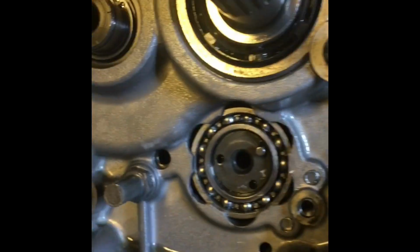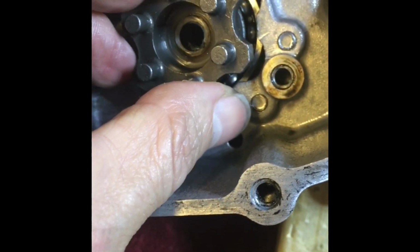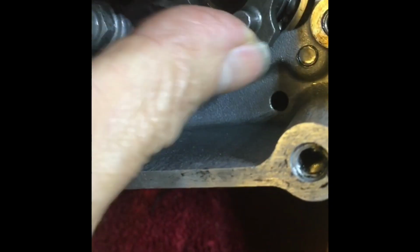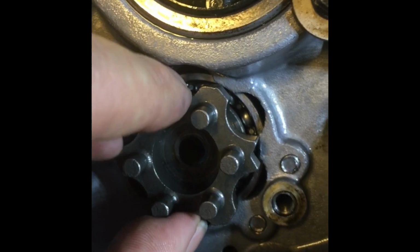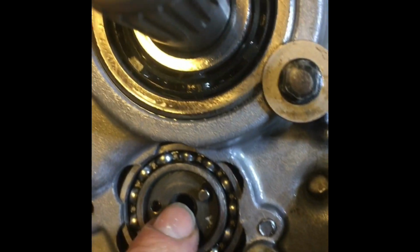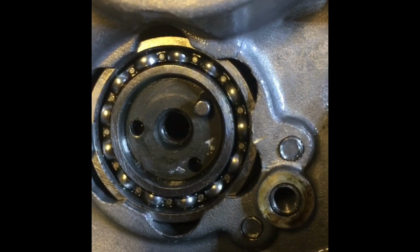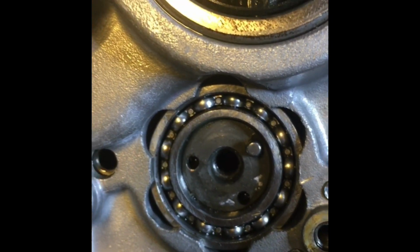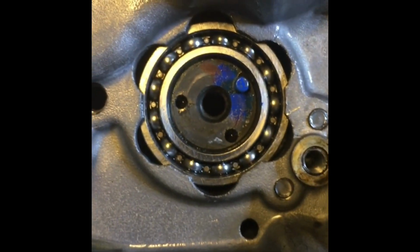Now here I had pulled the spring off for this shift tension mechanism, and pulled off the shift star as well. And I knew there was a little bitty pin, because I had seen videos of other people. That little silver thing, that was a little pin. And I was just seeing, okay, could this fit different ways? Like, there were 3 holes on the other side of that shift star, and I was like, man, what if I put this wrong? And then I realized that, no, that pin is actually bigger than the other holes on the shift star, so it can only go right there. It can't go anywhere else. And then the star that pushes into it, it's got only one hole that pin can fit into. So that was a bit reassuring. But nevertheless, I marked it with nail polish and blue paint.